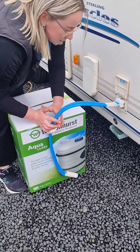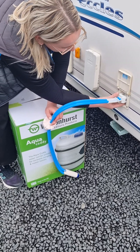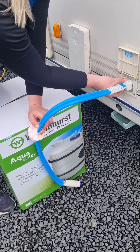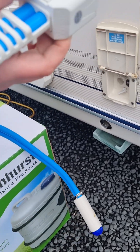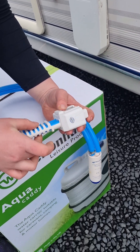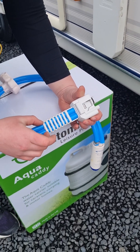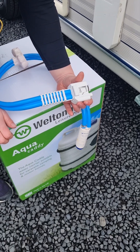When you're going to remove this pump, make sure you squeeze those little flags out of the way. You're going to need to squeeze the buttons on either side of the pump and pull it out. Make sure when you pull it out that you pull it out by this head piece here and not the little skeleton on here, because if this breaks it lets air in and then your pump will just suck air and not work.